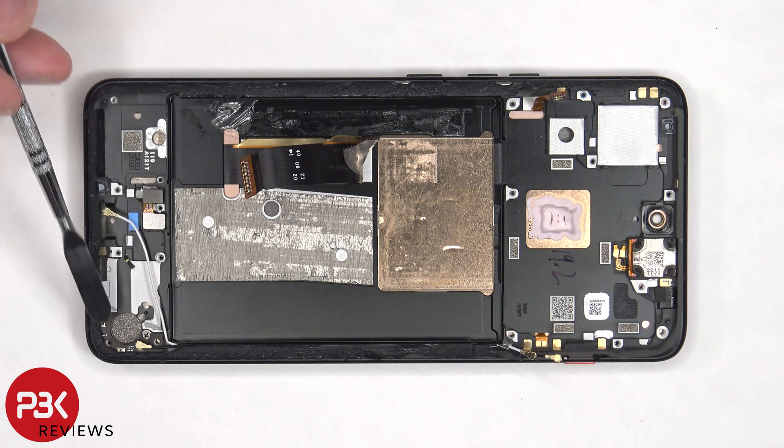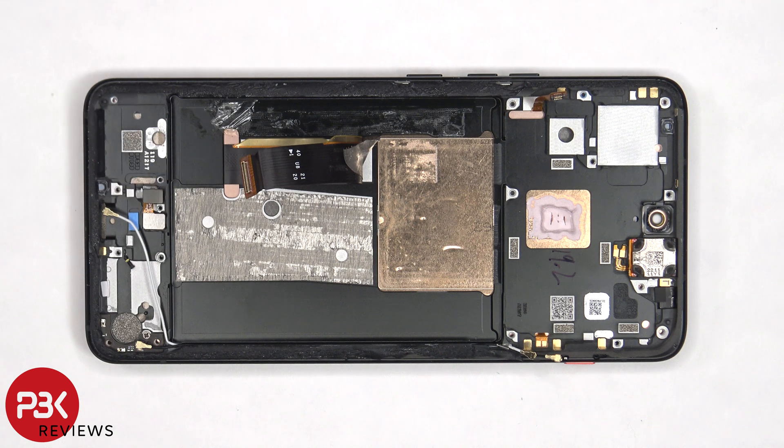There's a small antenna board on the bottom corner of the phone. The fingerprint sensor itself is held down with some adhesive. The flex cable for the volume keys and power buttons routes through an opening in the mid-frame, so if you need to replace that, you'd have to pry the screen off as well. The earpiece speaker is located on top, and that's also held down with some adhesive.